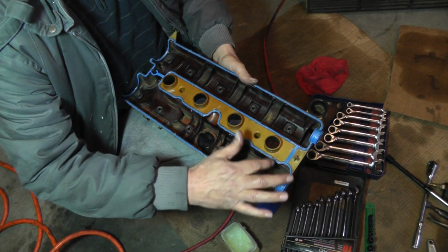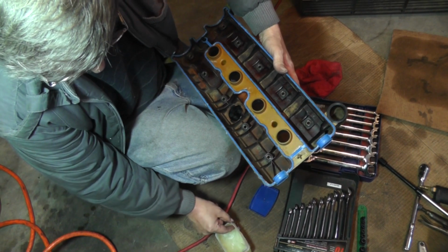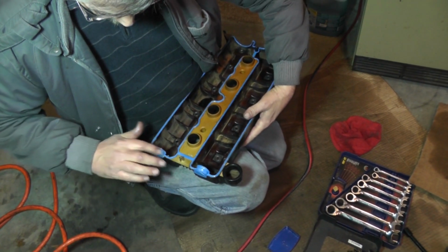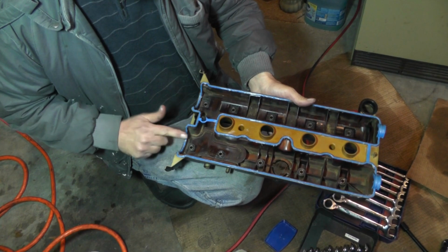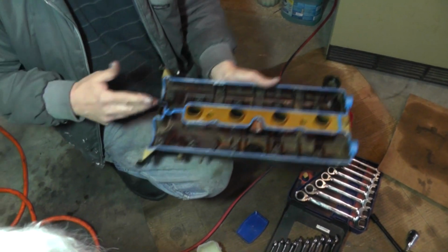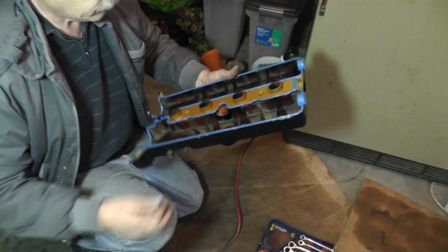All right. So what I did is I went to Lowe's, got some 6mm stainless steel washers. Washers are 60 thousandths of an inch thick. Okay, so I'm going to put 2 of them on there. All right, 2 of them on each bolt. That'll give us almost that 1/8 of an inch plus the 1/8 of an inch that's already there. So that'll give us a 1/4 inch. I think we'll be okay. So this thing should make up pretty good.